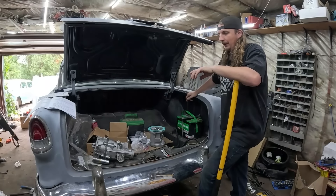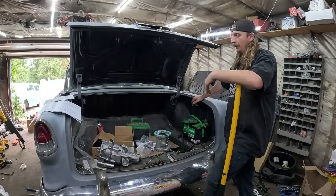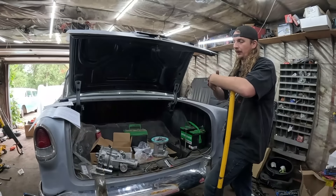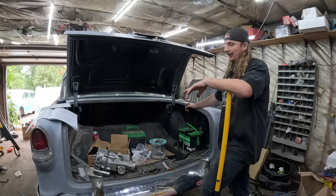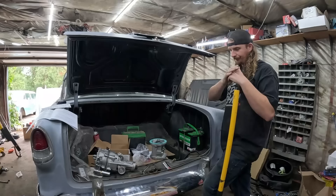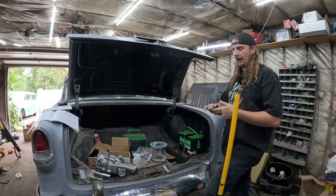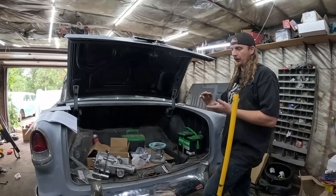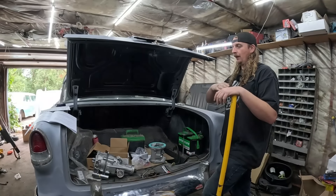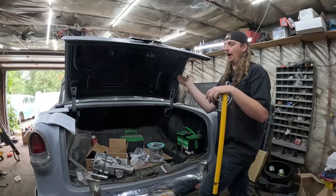Which is good for a lot of things — towing obviously is kind of what I think it was originally meant for, but you can split gears and do whatever you want for passing on the highway. If you don't want to drop all the way down to second gear, you can go second over and sail. He believes it's really good for off-the-line performance too. You rip through first gear and this thing has a couple of different options. You can manually turn it on, or it has some sort of auto-shift at a certain mile per hour — you whale through first and it goes first over, staying in the power band that much longer.